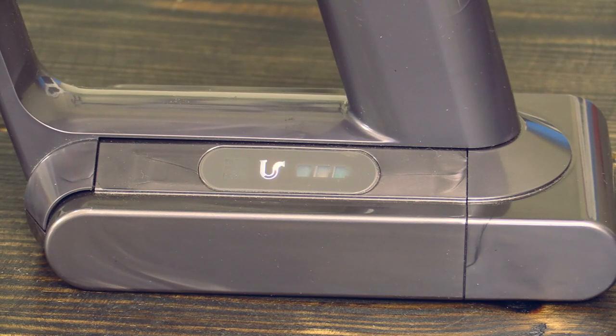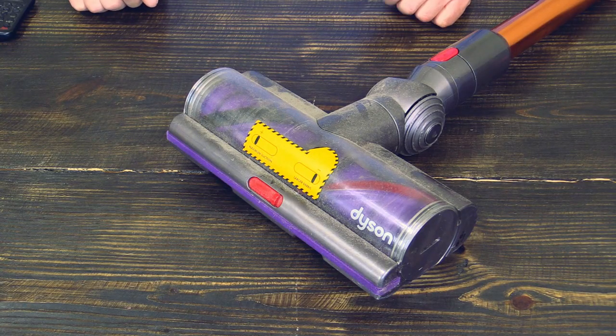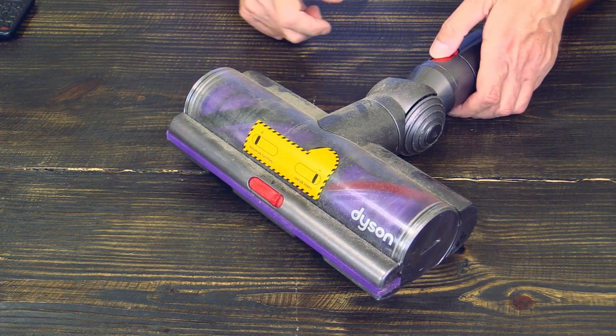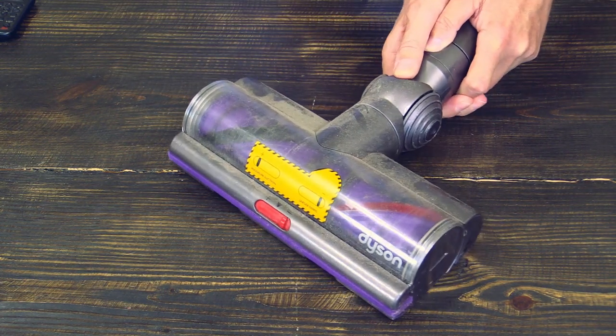Some of my subscribers asked me what to do when this LED, when this logo is flashing on their Dyson V10. When this light is flashing, I'm sorry to say, but there is a blockage somewhere within your Dyson V10 and needs to be removed. First, you have to remove the direct drive cleaner head from your Dyson V10.